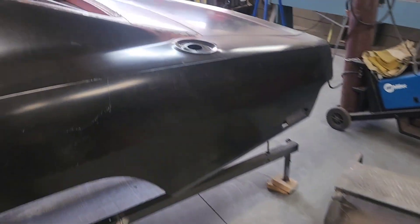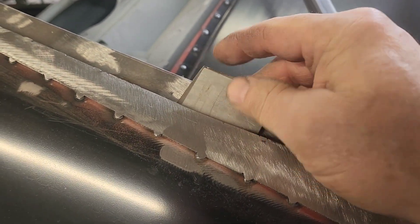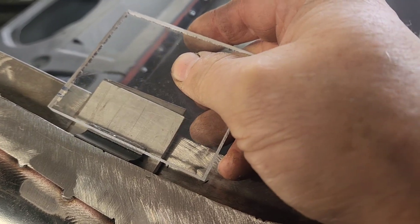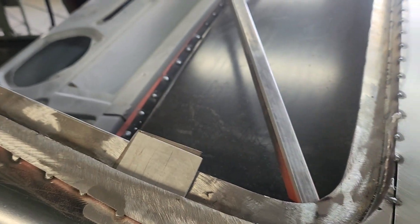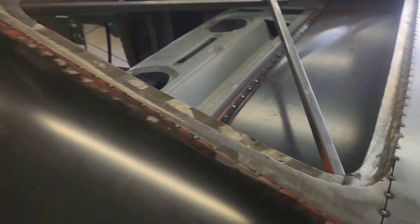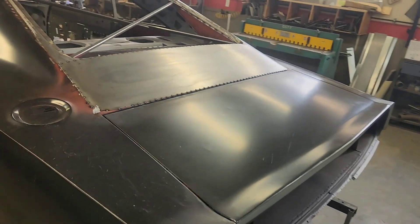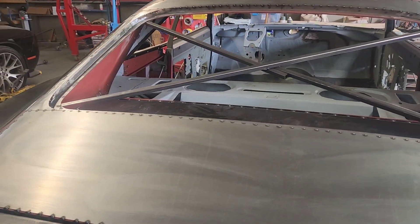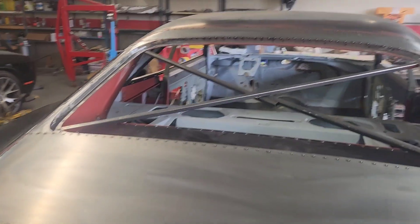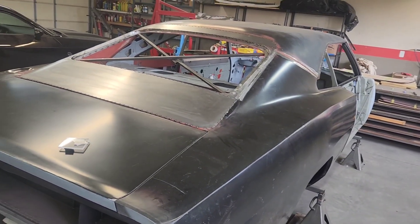The glass is about an eighth of an inch down from the roof at the top and about a quarter of an inch down on the side. It looks good on this car but it's a little too deep. I have three-quarter inch deep sides on this bed, so I'm going to have to build up and pack the depth to get the glass up a little flusher. If I put the glass down in here it's just too deep for my liking. I'll have to get three-sixteenths inch material because the actual dimension should be seven-sixteenths of an inch deep - that's what it is on the top of that windshield to the bottom of the bed. Anyway, that's going to be it for this week - I appreciate everybody for watching and I'll see you on the next one.